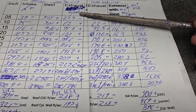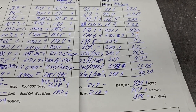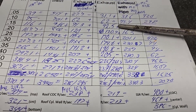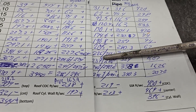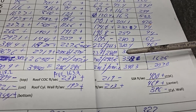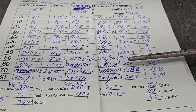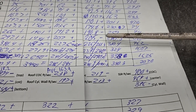We're going to compare our exhaust with a radius — and this is the exhaust with a radius. I know for a fact it's a different valve, and I did make the radius a little bit smaller. We'll see if it's a win or a loss. We got plus, equals, plus, plus, minus, minus, plus, plus, plus, plus, plus, plus. Max is out at 295 with a pipe, which is not bad. Remember, I didn't make that exhaust huge — the outlet is exactly the size it was. I didn't do a ton of redesigning; since it flowed as well as it did, I didn't think we needed it.